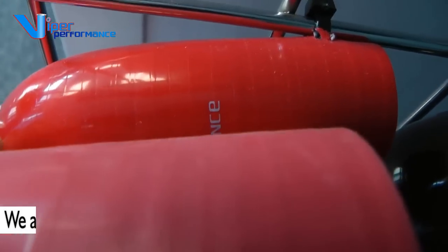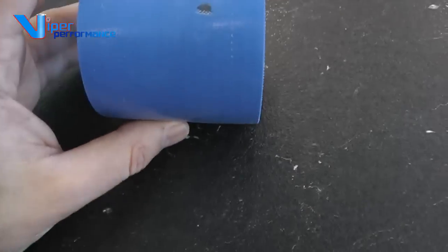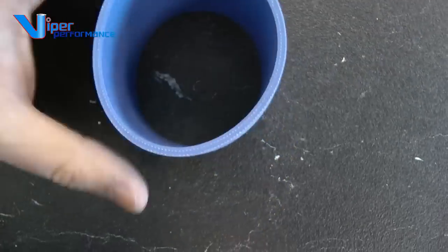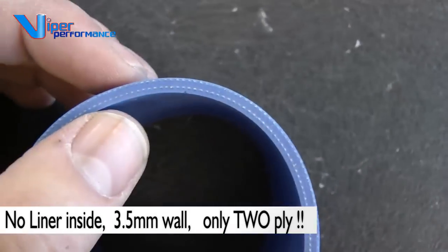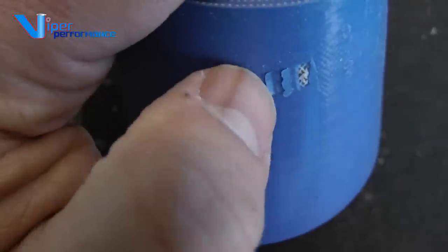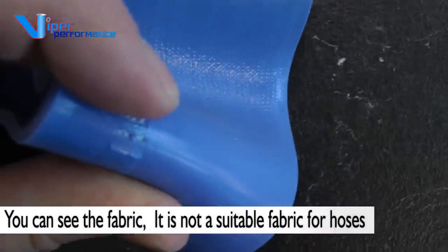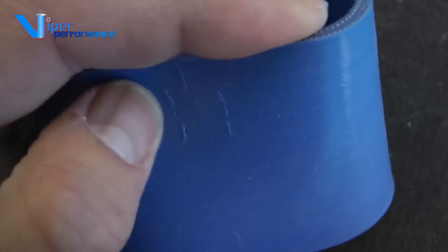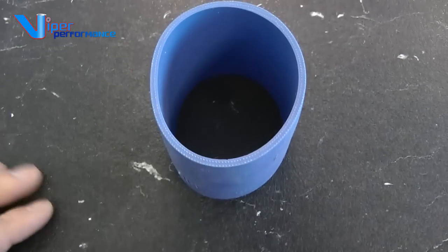But this is the Viper Performance Red, and this is the colour that you get. A customer brought this coupler in to us — they bought it on eBay and claimed to pay just £2 for it. Well, £2 is far too much. This should not even be sold — it should go straight in the bin. The material is so thin. It was half the price of a Viper Performance hose and there are only two layers of reinforcement, extremely thin, with a cheap quality fabric. That's almost like a mosquito net — you might as well use a piece of paper. The layers are so thin that you can see here where somebody's clamped it. You can see the cheap quality fabric underneath, which is not even sticking to the silicone very well. There is no strike-through of the silicone into the material. So just by clamping this, you've ruined the hose.